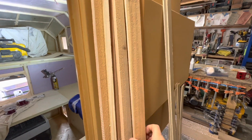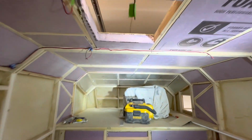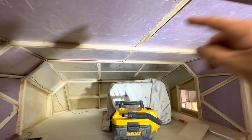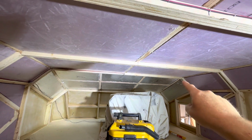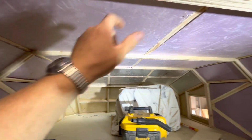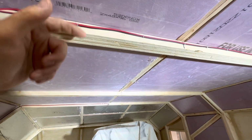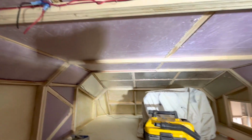So we've got a combination of half-inch cedar, oopsies, and I cut some strips of some leftover quarter-inch ply. And what I will do, I want to get the wiring in before I do this, but I will actually take those pieces and attach them here all the way across there and down there for all of the columns going across. So I'm considering the column really kind of a multi-angular piece there, because it's a 45 up, the long flat portion there, and then the back down. So when I attach those ribs in there, and I'll show you guys in other videos, it'll probably make a little bit more sense, but what that will do is build up the thickness of this to where I have another 2 inches of thickness. And then ultimately, I will put 2 inches of EPS insulation.